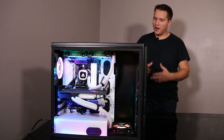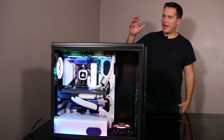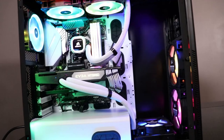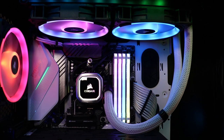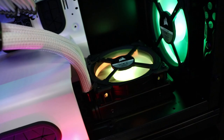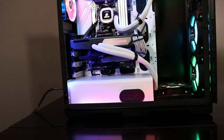So as you can see, we are up and rolling. I was already able to install Windows, and I am just so thrilled that this thing is finally together after months and months of lurking for parts. So let's take a look at the finished product. We have the two 140mm fans up top — mathematically it just makes sense to put both of those on the 280mm radiator. I also have the other two 140mm fans up front for intake. Because this GPU is only compatible with a 120mm fan, I went ahead and put another 120mm fan on the rear exhaust just to make sure we have as neutral air pressure as possible.